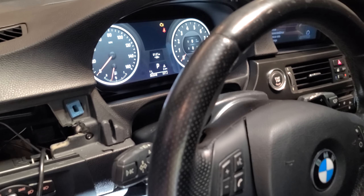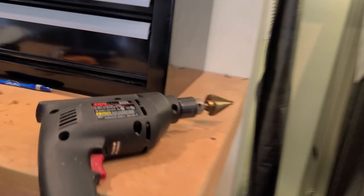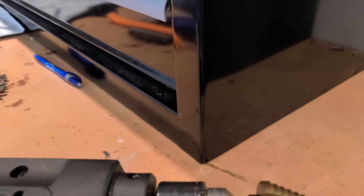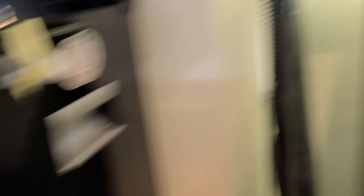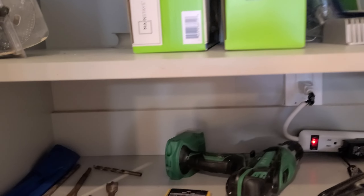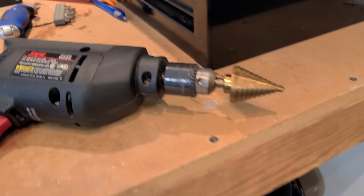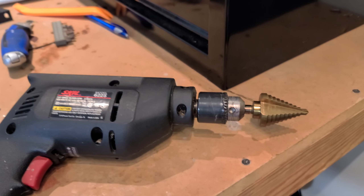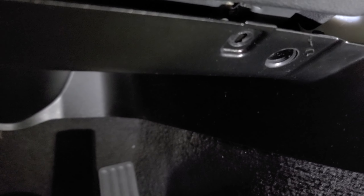Software update just finished and the cluster rebooted. Got my variable step drill bit on here to drill for the USB mount. The included mount tool is so ghetto — there's no way I'm using that under the dash. The only issue now is I don't have a tightening tool for the drill, so hopefully I can get this tight enough. Just started drilling my hole right here — it's not big enough yet. I already tested the USB cable by feeding it through the hole, so I'm going to drill that out just a little bit more.